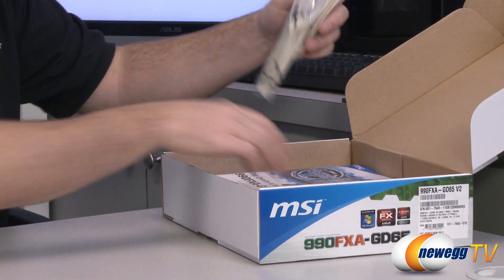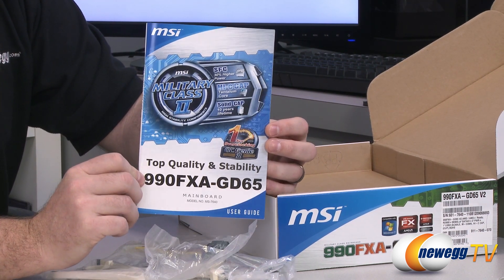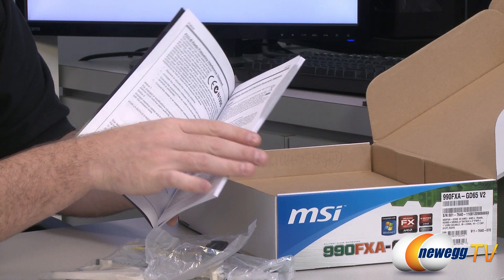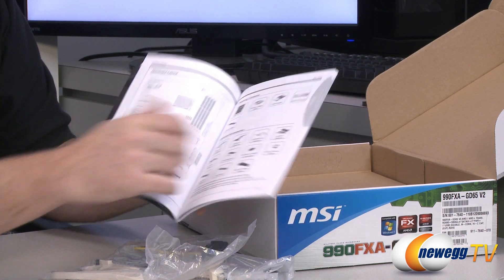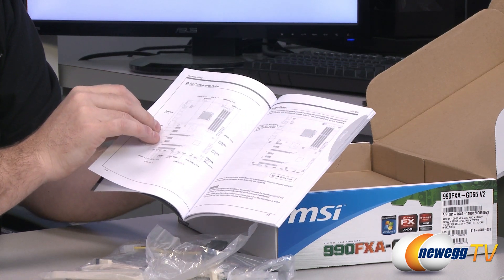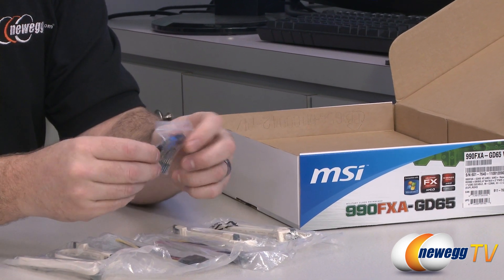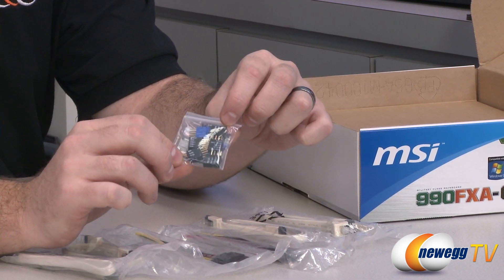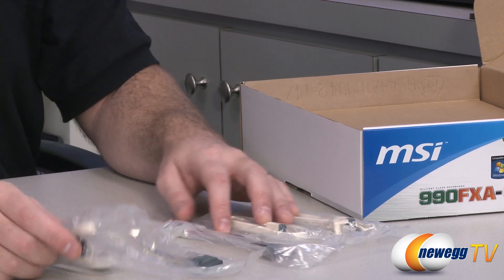You can also reference Newegg TV's how-to build a computer video tutorial on our YouTube channel in the tutorial section. The main motherboard manual for the 990FXA GD65 is here — definitely keep this on hand during your build, as it walks you through included components and important details like which DIMM slots to populate. Finally, there are M connectors from MSI so you can plug individual leads from front panel inputs or USB ports into these blocks, making it easier to connect them to the motherboard.